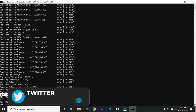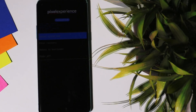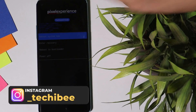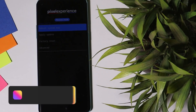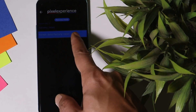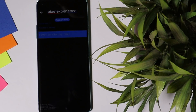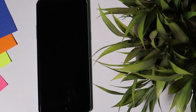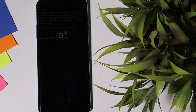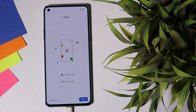After the ROM is successfully flashed, you'll see a message saying enter recovery, factory reset, and reboot your device. On your device you will see Pixel Recovery. Perform a factory reset by tapping on factory reset, then format data / factory reset. Once done, go back and reboot your system. Your device should successfully boot with Pixel Experience ROM based on Android 11. We have successfully installed Pixel Experience ROM on OnePlus 8, and this method applies to all OnePlus 8 series devices.